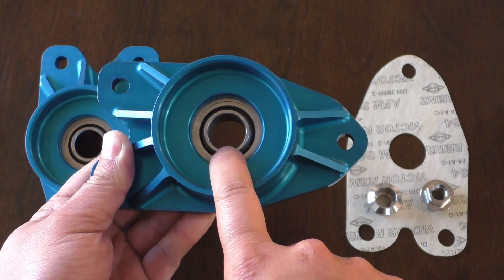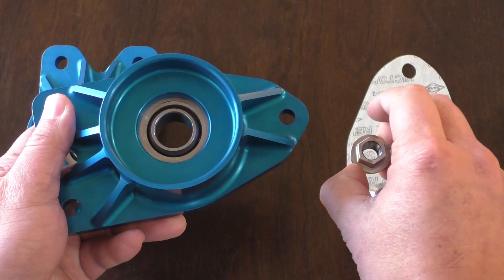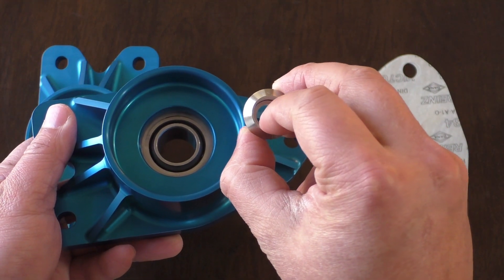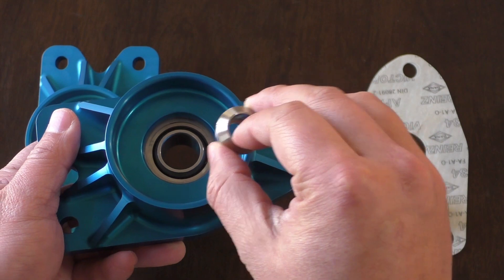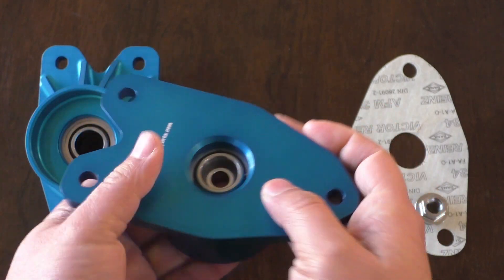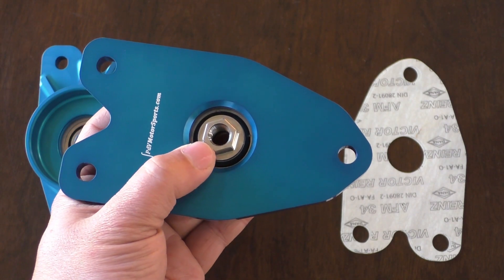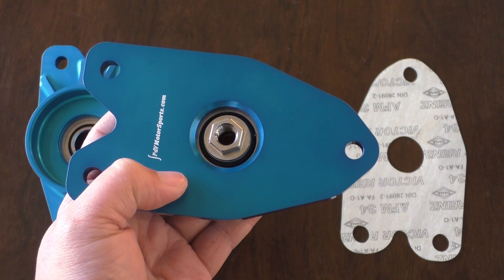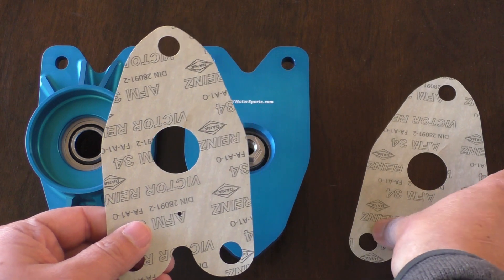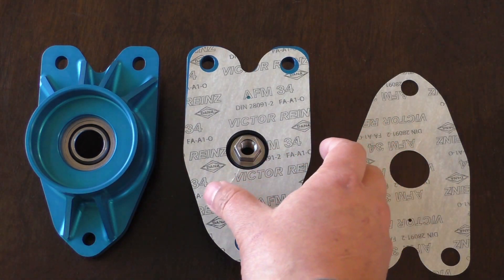In the center there's a pretty good-sized spherical bearing, and PDV gives you some adapters for your shock absorber — one for the lower, where your damper rod will slide in, which will then go around it and be inserted through the bottom. On the top side, you have your mounting nut which threads against the top threads of the damper rod. Another nice touch is that PDV includes a replacement set of the OE moisture-sealing gaskets which go on the top.